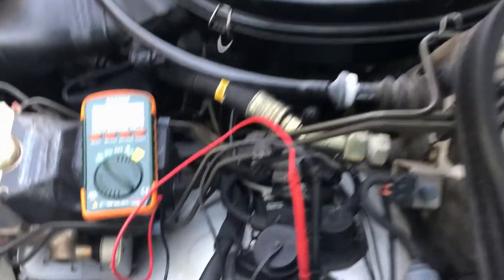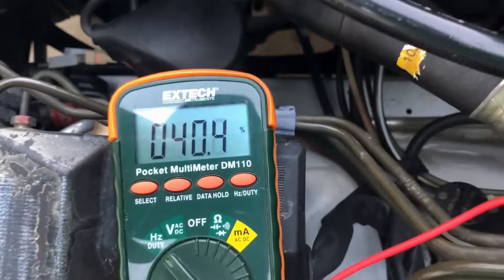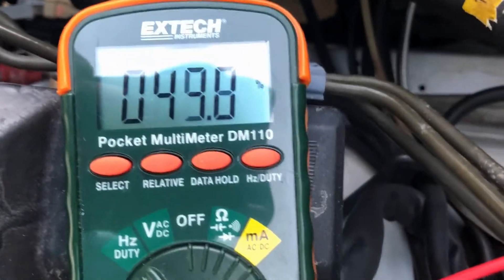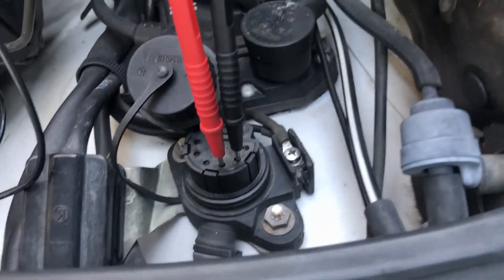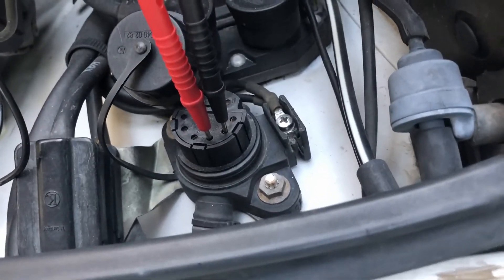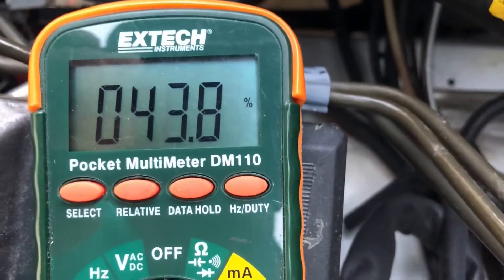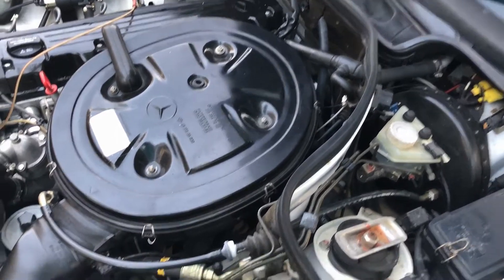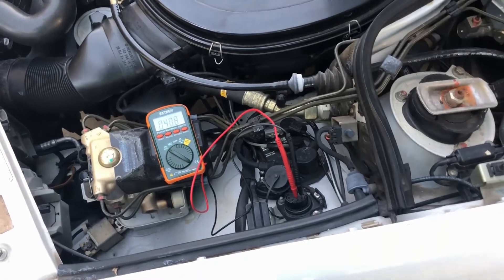The EHA is back on. Air cleaner is back on. And the duty cycle Hertz duty cycle is working again. I have to adjust it up a little bit — let the whole thing warm up. If you noticed in the previous video, in the beginning I wasn't getting anything like this. This is normal — it should be fluctuating like that. I do believe that a bad EHA valve leaking will mess up your duty cycle reading — you won't be able to read it.